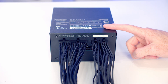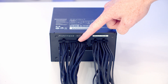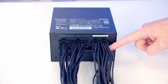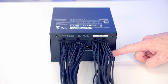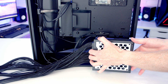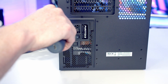The power supply is fully modular. Pre-plug the 24-pin cable, two 8-pin EPS cables for the CPU, an 8-pin PCIe cable (using the 6-pin connector for the Lian Li Uni fan hub), and a 12V high-power cable for the graphics card. Orient the PSU with the intake fan facing outward, set it into place, and secure it using four screws labelled 6-32x6mm.